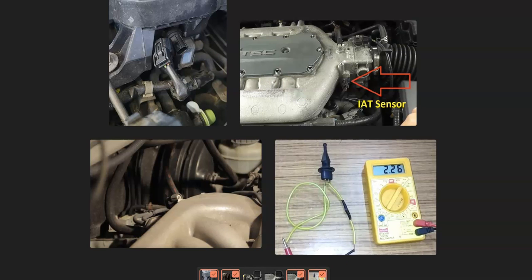To summarize: if you have a Honda with the P0112 code, first Google where the intake air temperature sensor is located on your particular Honda, as locations vary — it'll be on the air intake somewhere, before or after the air box, or near the throttle body. Check all the wiring for open shorts and blown fuses, and get the schematics for your specific Honda. Once wiring checks out, either test or replace the IAT sensor, and that should solve the issue.